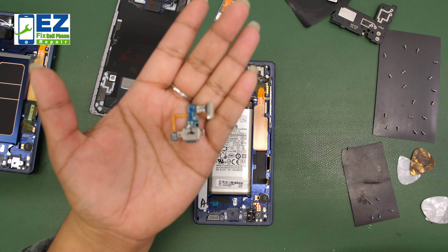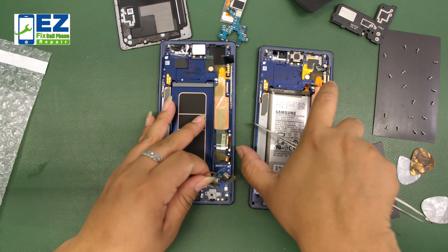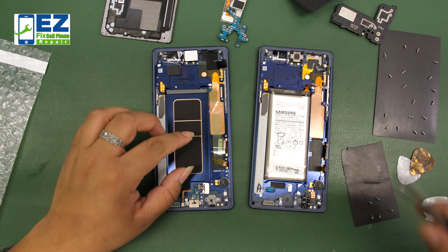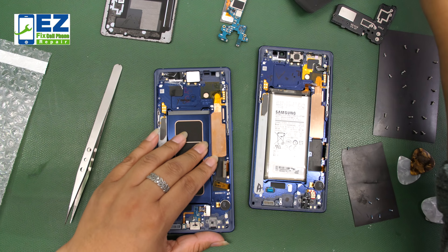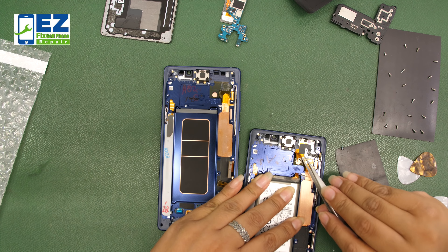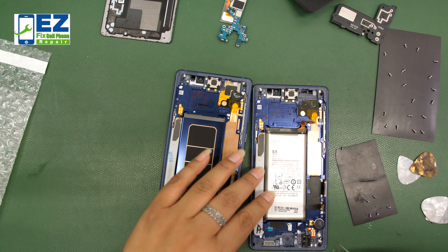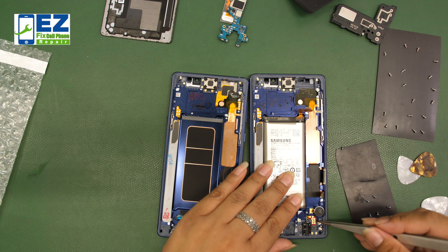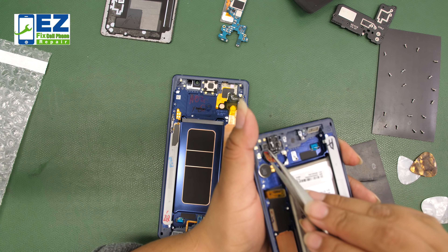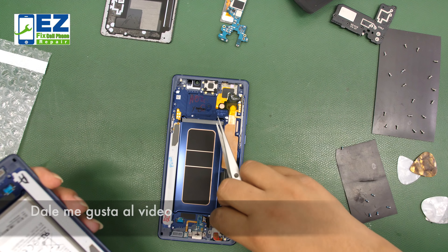You'll need all those for the antennas to work correctly, or you will not have a signal as strong as before. You'll have a very weak signal, so be careful. Make sure all the copper pads are touching on the connections when replacing everything back onto the new screen. The copper grounds to the actual housing of the phone — it helps maintain the signal and the grounds to the components on the logic board. As you can tell, Erica is transferring over the cameras, the headphone jack, and the vibrator to the new housing as well.